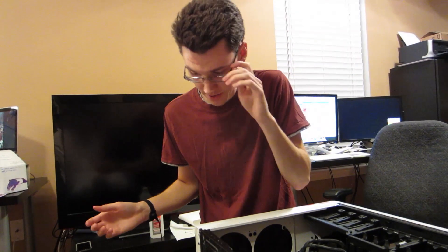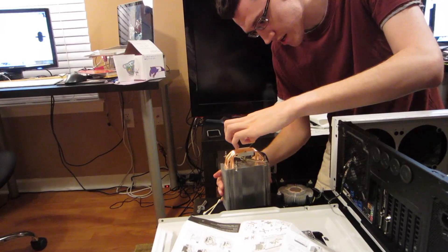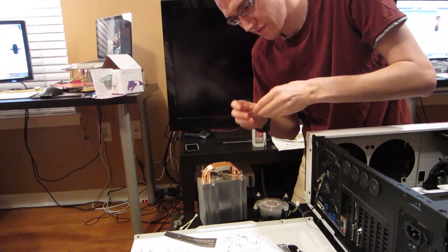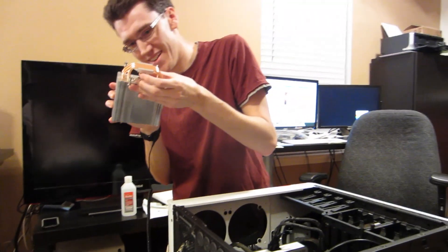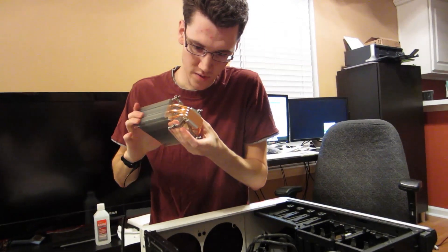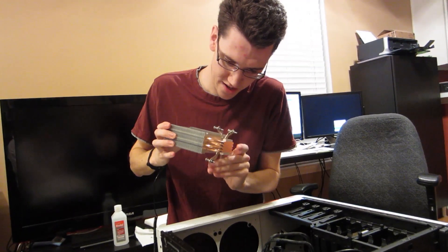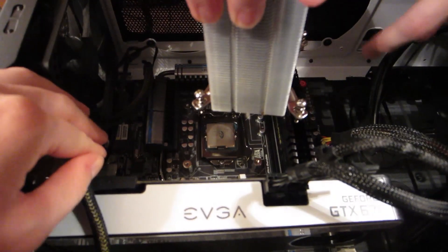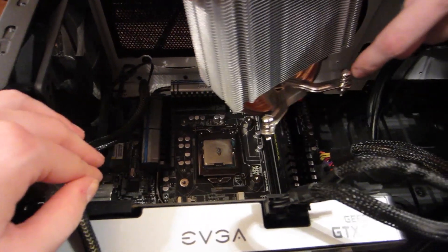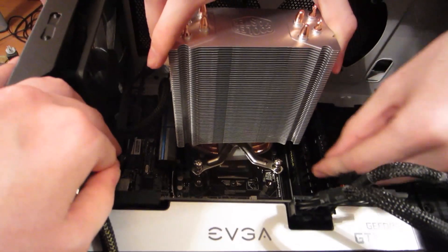What we have to do next, from what I understand, is peel this thing off — this is the protective coating on where it's actually going to connect with the thermal paste. As a reminder, I've never done this before. We have to sit this down onto the thing. Since it's square, it can actually sit in any direction — we can have the fan mounted on any side. I think it makes the most sense to mount it this way, because it probably gives it the most clearance. It looks like that's going to be fine.